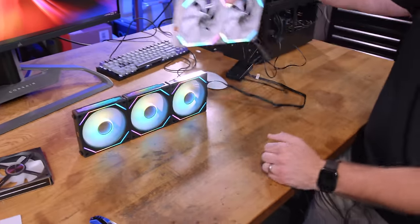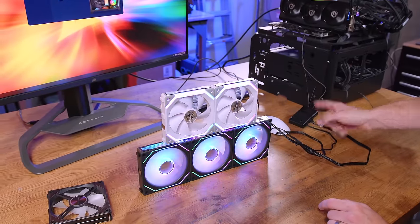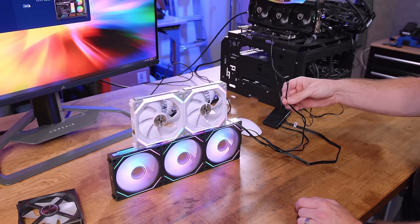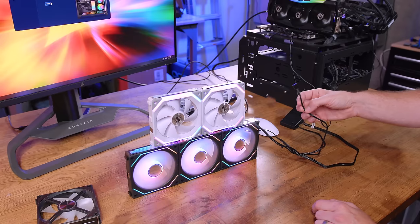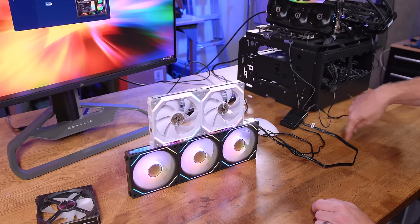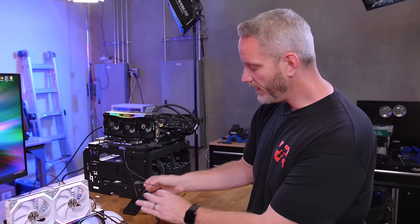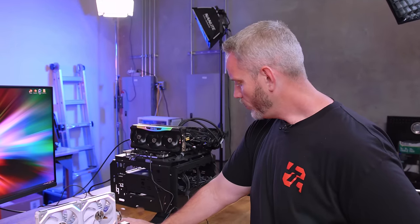You can see how all these are syncing together. The JST fan on top says 'no fan' because there's nowhere to plug the fan header in — you'd need a splitter or to plug it into the motherboard. The proprietary header for the new fan has everything in one plug, whereas it was split on the older ones. They did consolidate everything into one plug, which makes it neater and tidier when running cables.